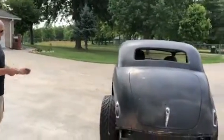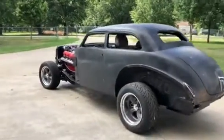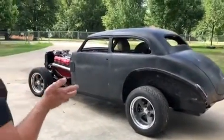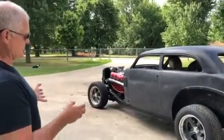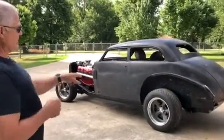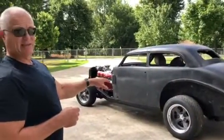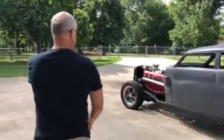We did a wheel-to-wheel brake conversion, so we've got 14-inch rotors front and rear on a Corvette hat to go on the suspension. And I used 4 pistons all the way around. We've got 11.5 by 18 Torq Thrusts on the back, 8 by 18s on the front.